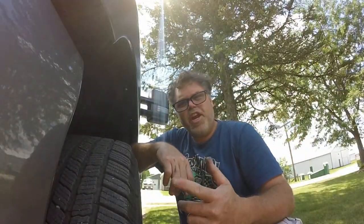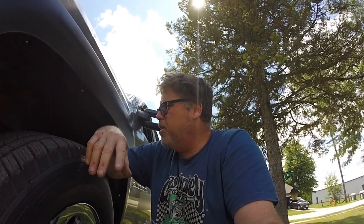We did it — no more dragging on the wheels. We got all our spacers on and everything is mint. So be prepared: if you have oversized tires on a Chevy Silverado and you want to put flares on with spacers, just remember you might have to do some trimming, especially up front.